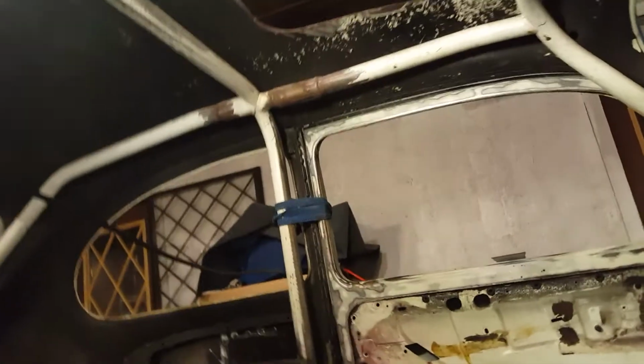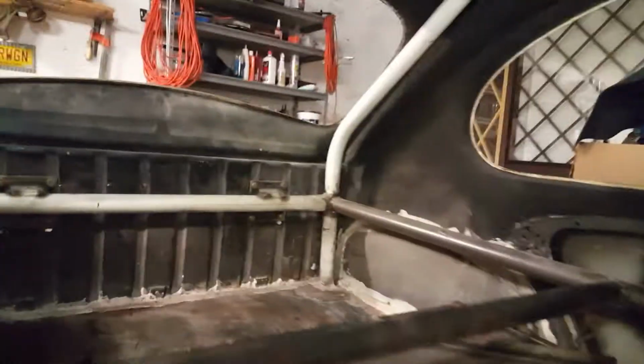You can see it's kind of bright with the weld there. Put in that plate, and then where the holes were, welded those in. Plug weld, I guess, is what it's really called. Welded all the way in the back onto the back pan. Then it goes through the firewall. I got those plates welded and bolted.